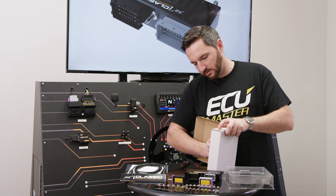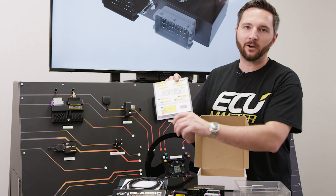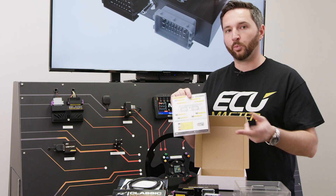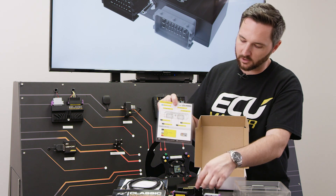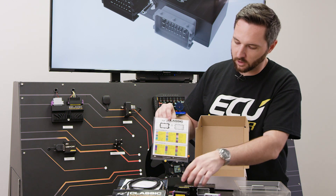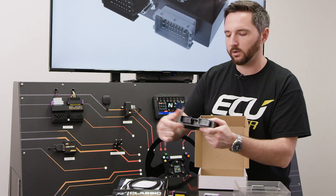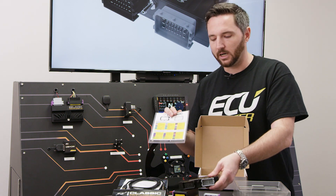At the bottom of the box there's a laminated pinout card with two sides. One side shows the Bosch 4.2 wideband wiring — this ECU is unique in that nothing else in this price range drives an O2 sensor directly; the Classic drives the Bosch 4.2, and the EMU Black can drive the Bosch 4.2 or 4.9. Use the MAP sensor port as your reference for orientation: on the black connector, pin one is top left and pin eight is top right; pin 24 is bottom right. Same layout on the gray connector. Be careful not to read the pinout card backwards — there's nothing worse than finishing your wiring only to realize that mistake.